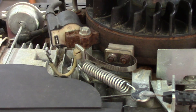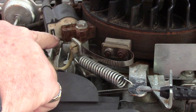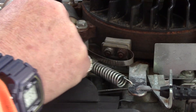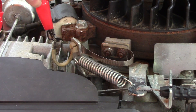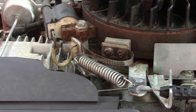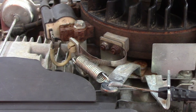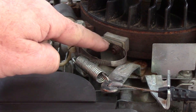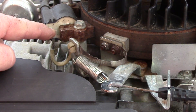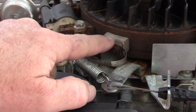We're back up on the table. We confirmed in that last test that the engine will shut down when we have continuity to ground. I was poking around online and realized what is supposed to happen: when we release the bail and that pad comes in contact with the flywheel, we're supposed to get continuity through the pad, through these two posts, through this piece of metal strapping, through this wire to our ignition coil kill ground.